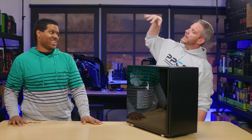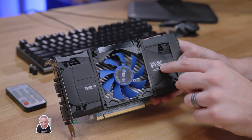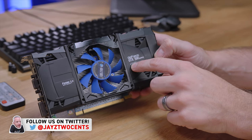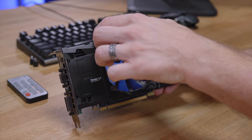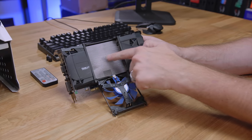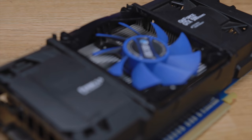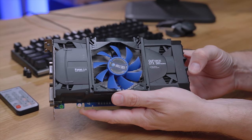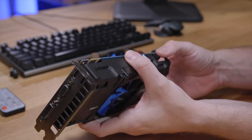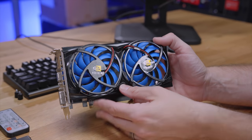Both these cards are fairly old generation. This one is labeled GeForce GTX 500 series, high-speed GDDR5 memory, with an arrow pointing to where the memory would be, and 'Fermi 2.0 GPU inside.' GPUs usually go inside the card. This is actually a Galaxy card with a flip-down fan so you can clean the heat sink - so it's not really a Chinese knockoff, but definitely a used secondhand card. This is Galaxy before they changed their name to GALAX. He said this card will run for about 30 seconds and then shut off with no signal, so I'm expecting a cooler-related issue. This other one is completely unidentifiable - a straight-up knockoff fake NVIDIA card. Even the stickers are crooked.